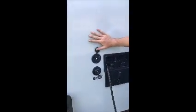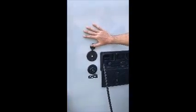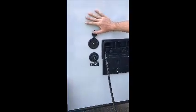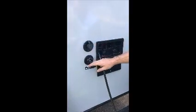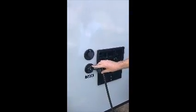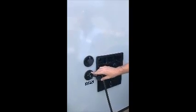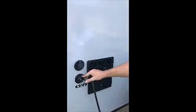So this is the cable connection. So if you're at a RV park and you want cable inside, hook your cable line up in here and you'll get cable inside. This here is your city water connection. This will pressurize your whole system inside without having to pull from your fresh tank or use your water pump. Put a garden hose right in here. This will pressurize your whole system so you don't have to worry about using your pump.